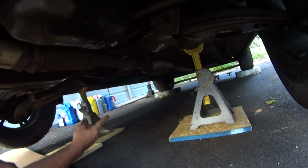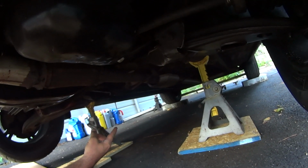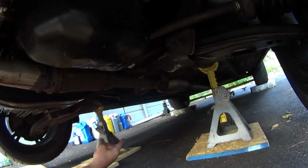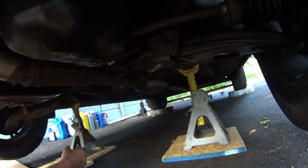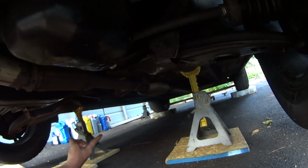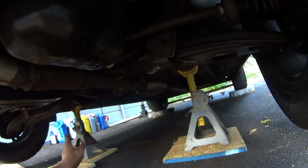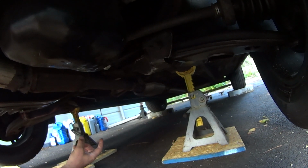We could just start here. Let's just unbolt this, and we need to look at. I'm planning on moving the cat back. Good. That's going to have to be on the back side of the hangers right now. Perfect. And there won't be a hanger on the rear of the cat. It'll just have one hanger at the front of the cat. It'll be harder for it to light off further back, but who cares? Yep. We're not emissions testing here. Nope. And there is a heat shield there. Yes, sir. So it's still under a heat shield, and it still has the bottom heat shield facing down, which is supposed to be that way. It's supposed to have one above it suspended and one attached to it below it. So we're going to move that catalytic converter back behind those hangers with like a couple inches to spare.